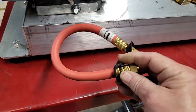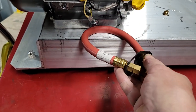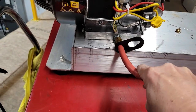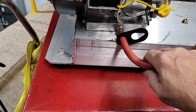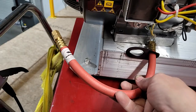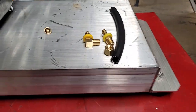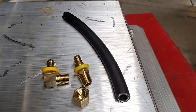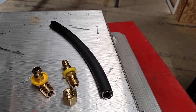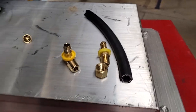In the past I had used these devices — it's a very popular little oil drain device. You screw it in, take that plug out, screw this in, and you should be good. But the problem with that is it's gonna stick straight out, and then you have to fold it over and put it in that little keeper. That don't really work well for me — I want it to come out at a 90 and run back here. I've been using this hardware: a quarter 90 push lock, a straight push lock, and a cap.